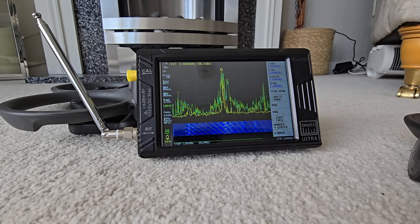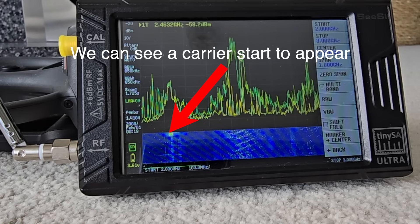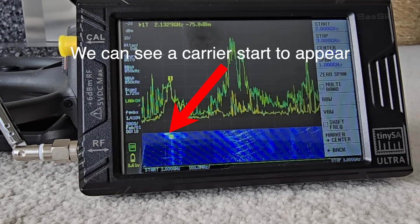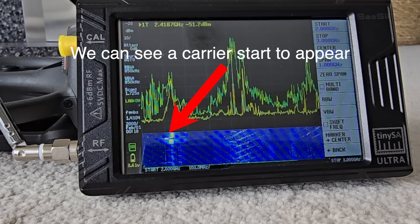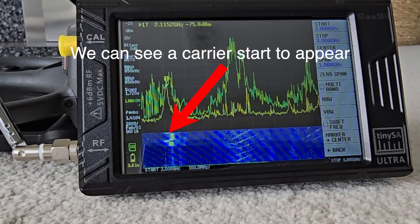Outside the front door: 60 megabits a second. Just at the end of the road, probably about 10 meters away, it's gone down to 38 megabits per second. Down the road, probably about 25 meters away, it's gone down to 5 to 9 megabits a second. Steadily dropping now. Back up to 10. Image quality's still good, but we're at 2 megabits now. Down to 2 megabits, 1 megabit. We're at about 1 megabit a second now, so I'm going to come back.